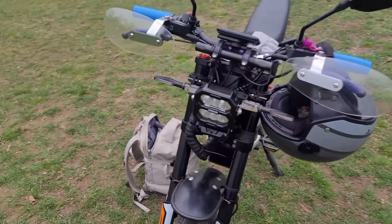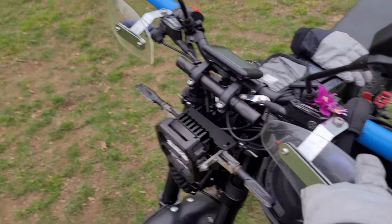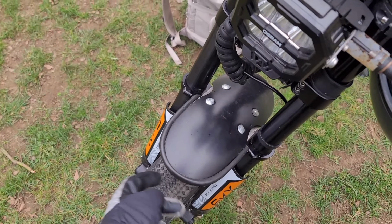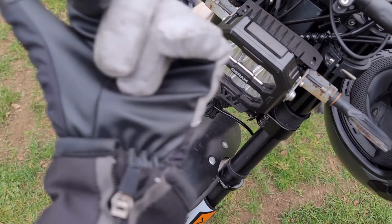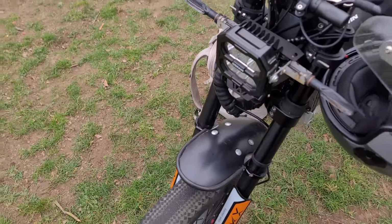They're going to look for the radius, how sharp any unbodied items are. So that's this and this, which is why I have this. The radius needs to be a minimum of 2 millimeters. Or you can just put something like this to make it pass.